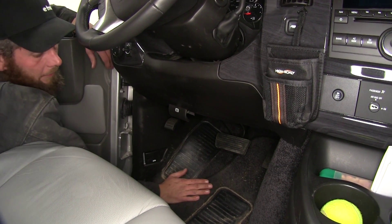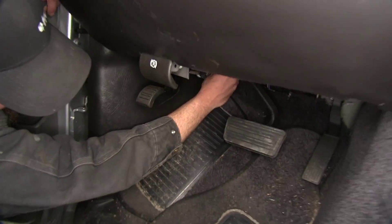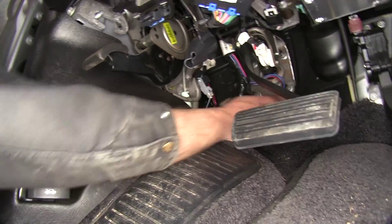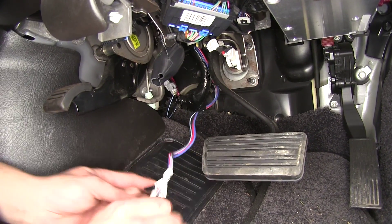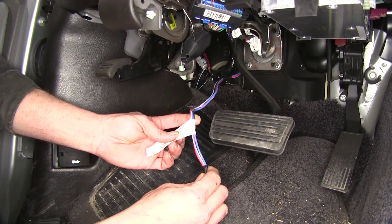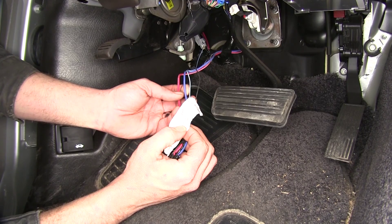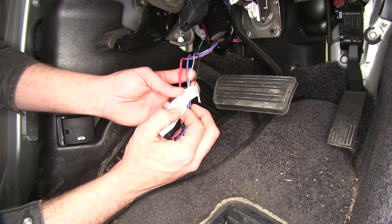To begin our installation, we're going to find the pre-wiring. To do that, we'll look just behind and to the left of the brake pedal — there's going to be a main wiring harness here running up and down. Typically, this bundle of wires — light blue, black, red, and blue — is going to be taped to that, but with this conversion it looks like they've just moved it and tucked it down here behind the carpet. The white piece of paper should tell us what we need to wire to what. The black is our ground, the red and white is our battery power wire, the dark blue is our trailer field or auxiliary, and the light blue with white is going to be for our brake light switch.